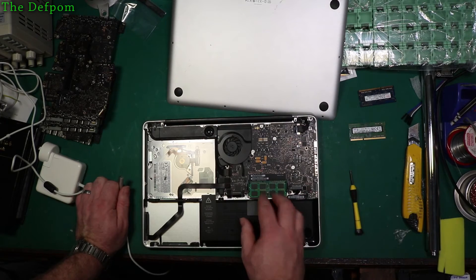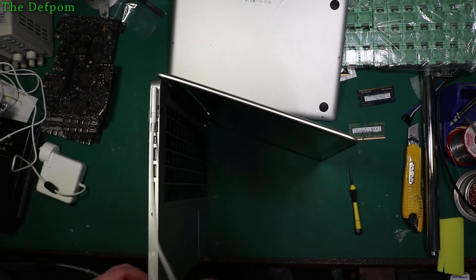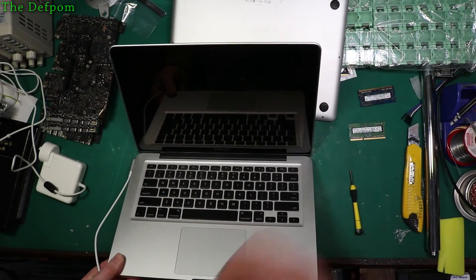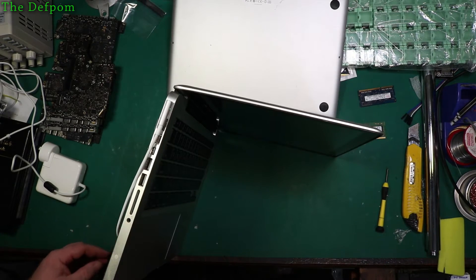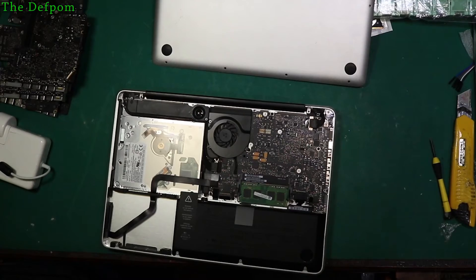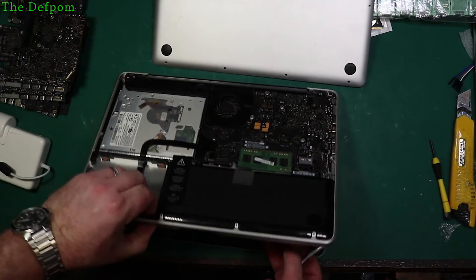I just want to see if this can actually fire up. You have fan spin. Still beeping. Maybe it's not RAM then, might be a supply issue. Maybe the supply which runs the RAM has got a problem. I was just doing some diagnostics work on this, I'll try and narrow it down. It's beeping like it's RAM, but it may not be RAM.